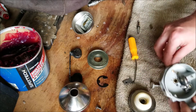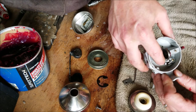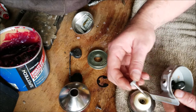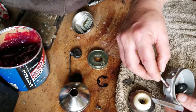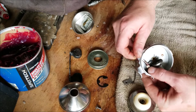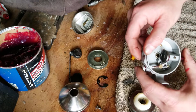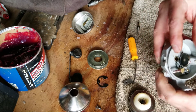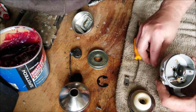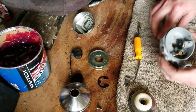I already have the larger gear in place. Now we're going to install the elbow piece — it goes in the small hole. Push it over this way, set that on top, add a little grease to it, and get it in place. Give it a couple turns to lock it in place. Don't forget that small retainer clip — put that in there. There we go, got that locked in place.